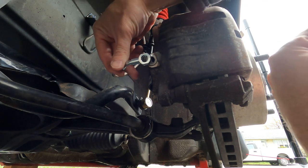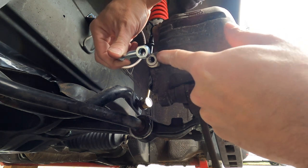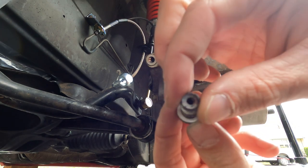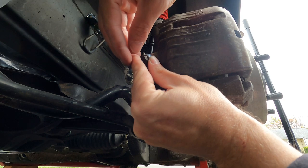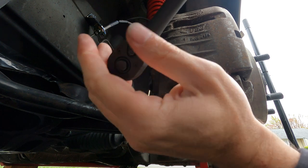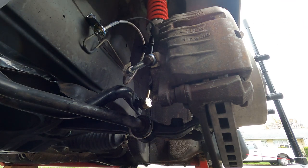I'm going to attach this brake line — it goes on just like that. This is the Russell stainless brake line. You can see there's a little flat spot right here; that's going to go against this little stub, so it's going to end up just like that. Don't forget your washer on top, washer on the bottom, and screw it in. I sprayed this with brake clean — this thing was pretty gunked up, it's 20 years old, never done before. Put the washer through, put another washer on, start threading. This is a 12 millimeter socket, and that feels pretty good right there.